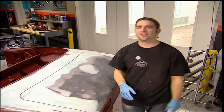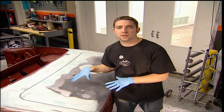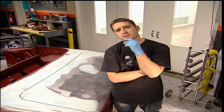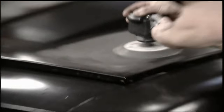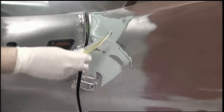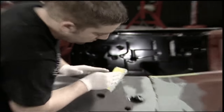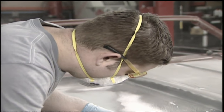That's enough welding and grinding for one day. We're gonna get back on our crate Camaro and break in our new muscle car paint booth, because today we're gonna prime and block this bad boy. We took the time to hang and adjust all the panels, and then to make the gaps perfect, we added metal and ground them to make all the gaps uniform. We used dual action sanders to create a mechanical adhesion on the whole car for a skim coat of body filler that bridged the gaps for show quality panel alignment. Then we finished the bodywork off with a final pass of glaze to fill in any porosity, and used a cut-off wheel and sanding block to finish off precise gaps.